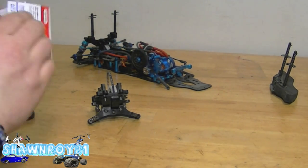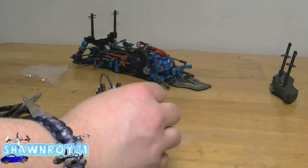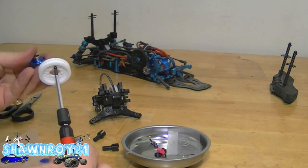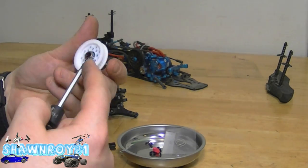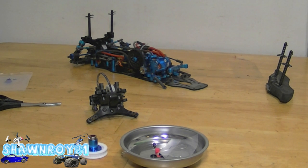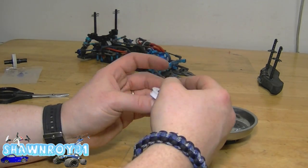Now we're going to start building our one-way. Install the pulley onto the spool with three screws, and as always, anything that's metal to metal, put some thread lock on there. Find the proper tool, put thread lock on the piece, and install that to the spool. Next step, we're going to use a retainer and add the diff cups. The retainer sits in between the diff cup and the spool, so make sure everything is sitting fine before installing it into the bulkhead.